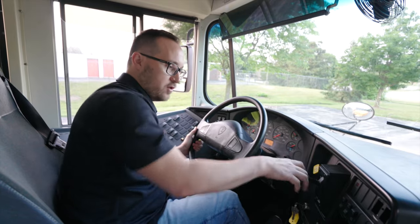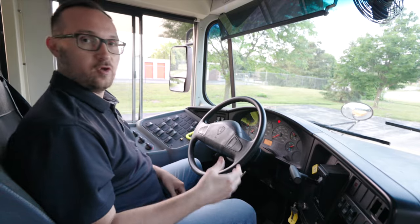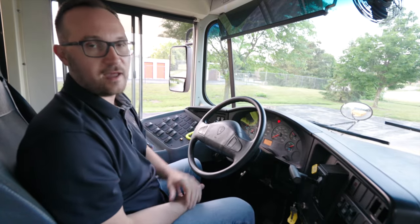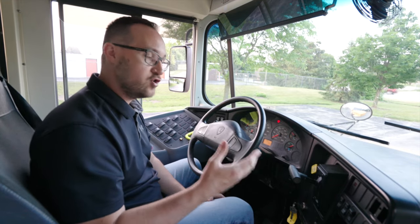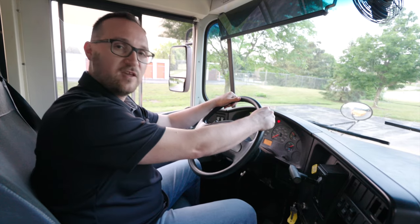Now I am going to put my vehicle back in neutral, pull out my parking brake, my parking brake light should come on. At the end of your brake test, you always want to take a minute to think, did you miss some item? Whether you missed the item on the outside of the bus, the inside of the bus, the student items light check, or especially the brake test, you can go back and redo those items, or ask your examiner if they would want you to show them those items that you missed, and they usually give you credit. The hydraulic brake test — you make sure you do that exactly how I did it in this video. If you fail the hydraulic brake test, it is an automatic fail on your pre-trip, and you will have to come back to do the full exam back over. So this will be the end of your pre-trip, thank you for watching this video.